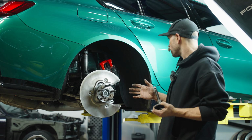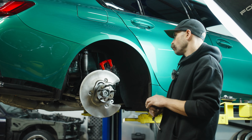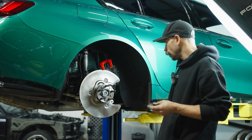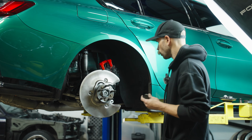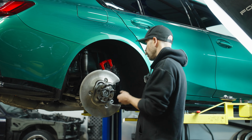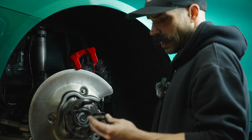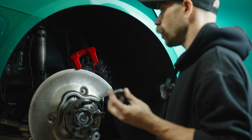All right, so we've got to get the caliper compressed now, and this may be a different style than what is in your standard compressor kit. We've got one that will work for us, but it'll work on a few different principles. So ideally, you would have a puck that has 3 pins in it that will fit in each one of these slots. But we've got a puck that is the right diameter to fit around the piston, and 1 pin, so it'll use the 1 slot to help us get the rotation.